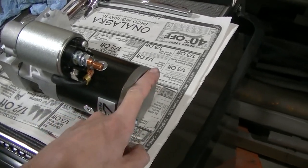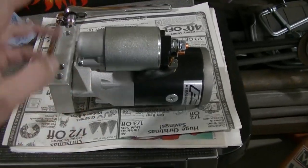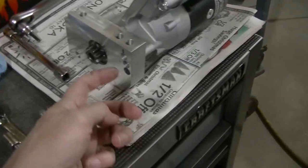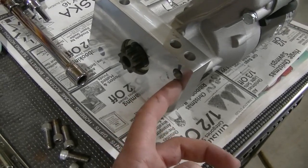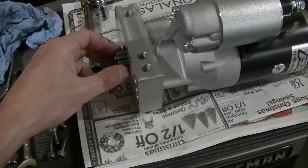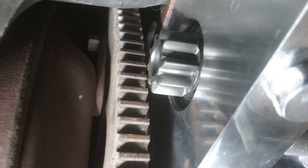There's no reason to go inside this starter. They talk about a hidden bolt somewhere inside the starter, but there is no hidden bolt. I think the instructions are for an older model starter, maybe before they were milling these out to be able to get to this one bolt here - you need an Allen wrench to get in there. When we bolt it up there, the flywheel clearance is really tight - a tight ten thousandths of an inch - so we got to move this starter back.